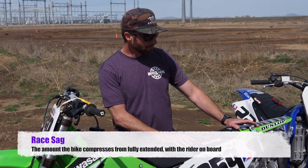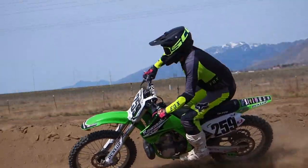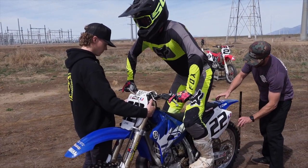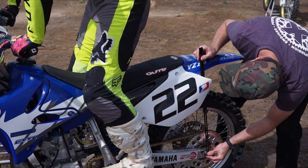The biggest thing you can do — or not do — to positively or negatively impact the rear is setting your sag. A lot of people have never adjusted sag, and you'll find that once you start playing with it, you'll notice how much it affects the geometry and handling stability of the bike. Once the rider is geared up, we'll set the sag for him. On this bike our sag setting is 103 millimeters — with the rider on the bike, on the ground on a level surface in his riding position, we want 103 millimeters of sag in the rear end to provide the correct geometry and balance.